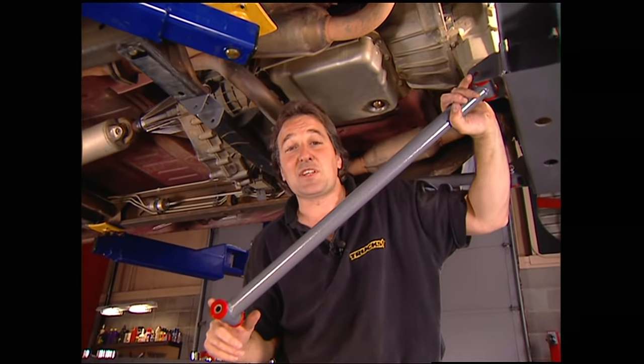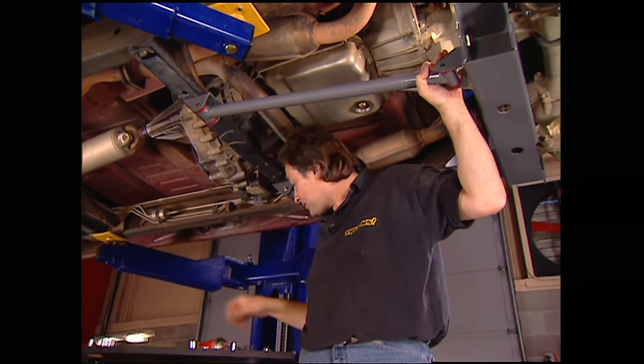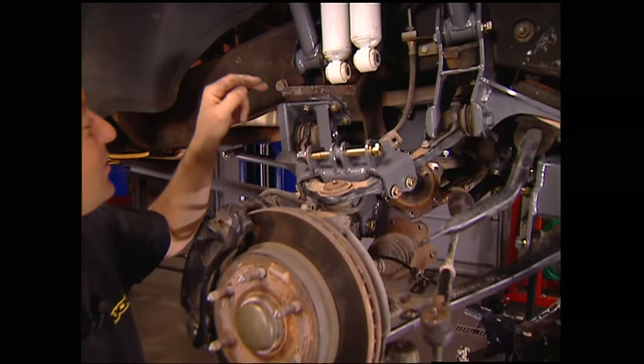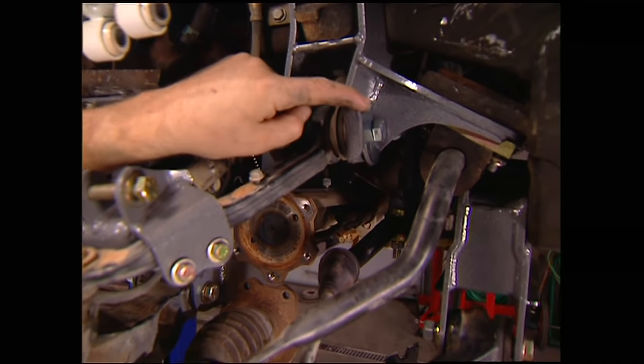With this much suspension hanging down, one good shot here and this whole thing is going to want to buckle back. To keep that from happening, we've got these braces that go into the cross member and then back to the transmission cross member — this supports the whole system. Remember, these are urethane bushings, so grease them or they're going to squeak on you. Finally, we're ready for the A-arm and spindle assemblies. Notice the A-arms slide right into these new pockets and the kit comes with new cam bolts for your alignment.